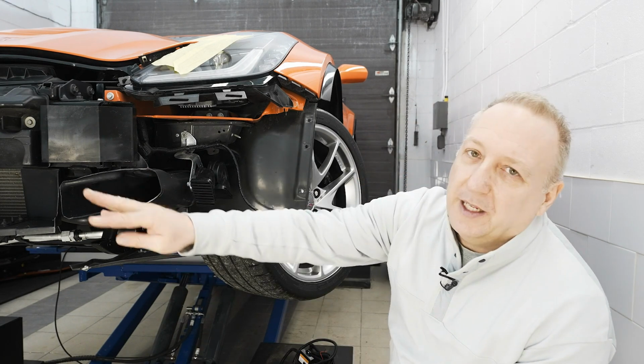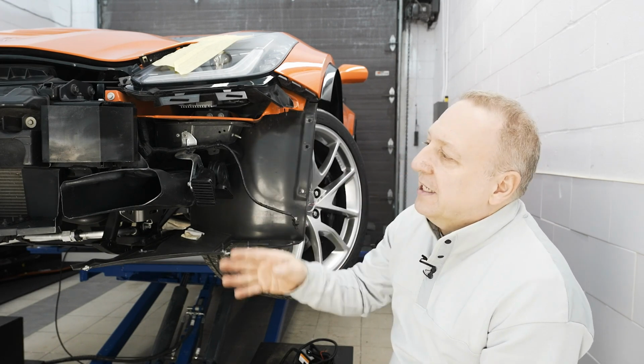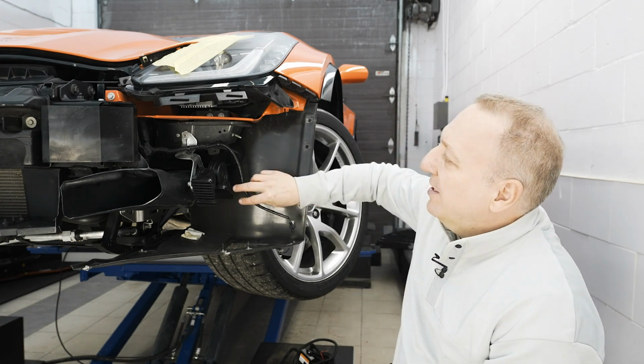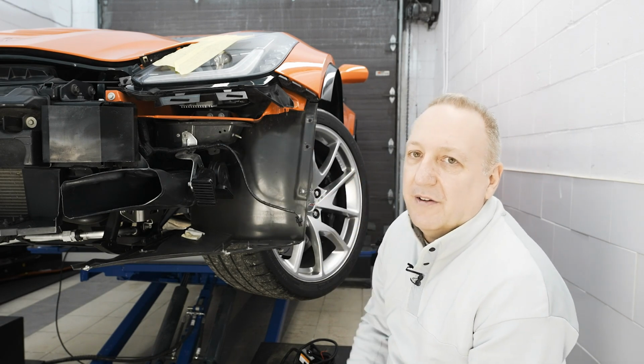So obviously we have two LED lights. We have to power them up. And the way that's going to work is we're using the side marker wire harness. Our LED lights are low amperage. They really do not consume a lot of power. So for that reason, we're able to tap into this circuit. This one circuit actually powers up the two amber side markers left and right.